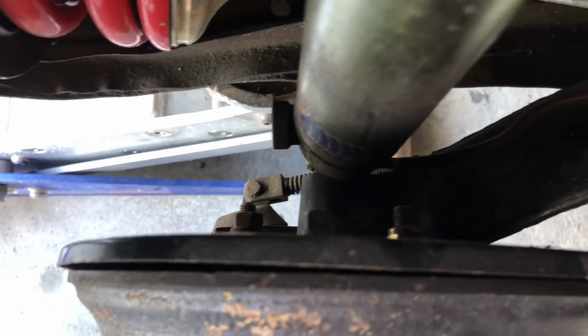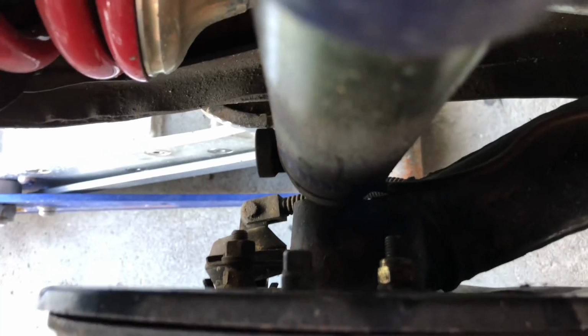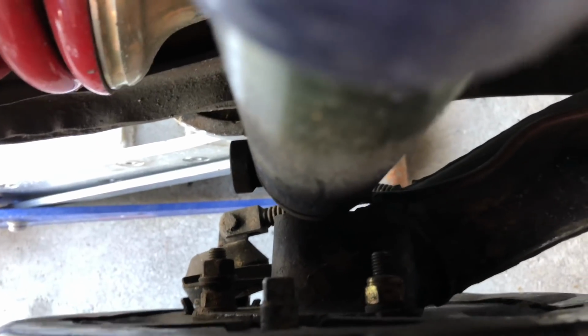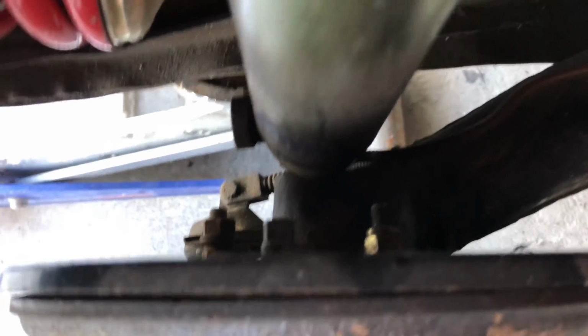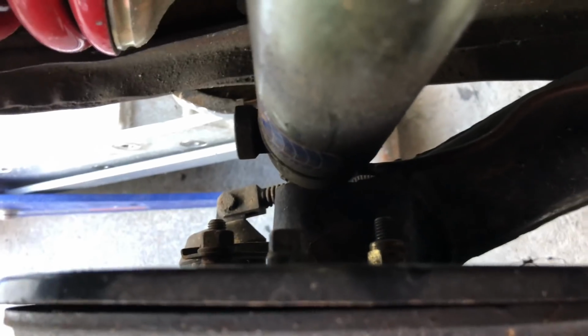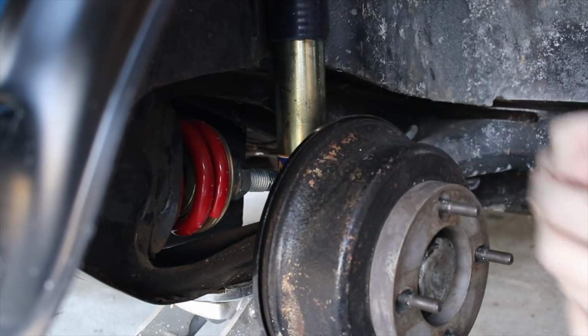The way I've been doing it, and the way that's been successful for me, is I have my parking brake pulled right now in a situation where this should stop it most of the time, but it doesn't. And I come back here and adjust this, see if this will spin. If it still does, adjust it some more, so on and so forth. So let's do that.